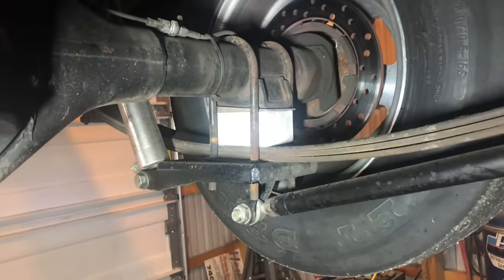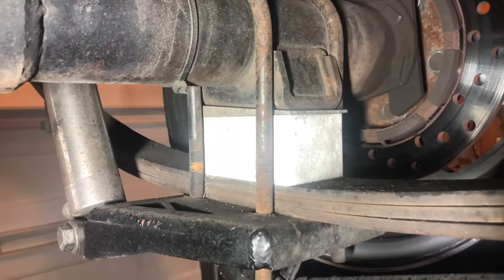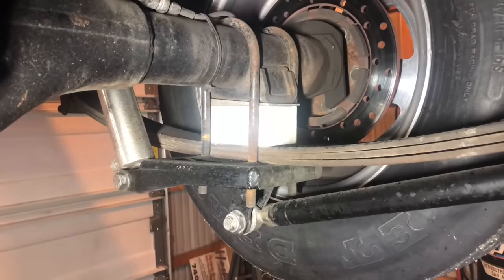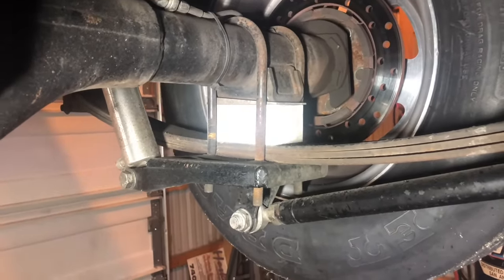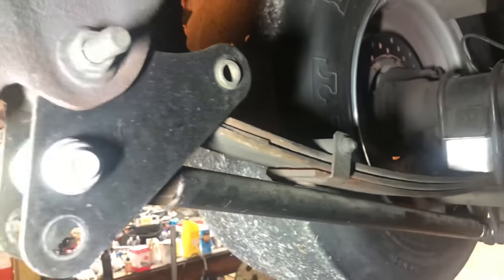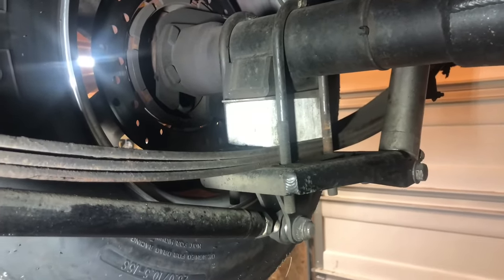The truck has four-degree wedges and a standard two-inch aluminum drop block — and no, they're not solid, they should be but they're not. That's a sore subject — I've been after my son to do something about that for a long time. There's a reason we use a drop block with a stock spring: one, because we're cheap, but also there's a real suspension geometry reason we haven't gotten away from it even though we could afford to change it now.